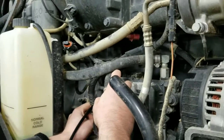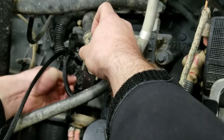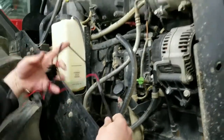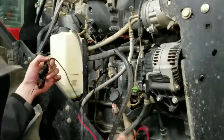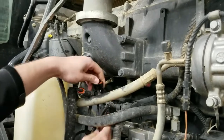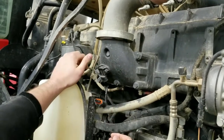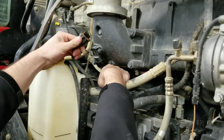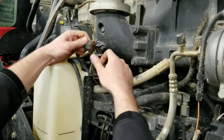Then we can go ahead and take the other ECM connector and connect it as well. Now we will take the female map sensor connector from our harness and plug it into the sensor itself. We use all factory OEM connectors, so we'll take the female portion from our harness and go into the map sensor. Make sure all connections snap into place — that's when you know they're connected properly, as we heard that snap. We'll now take the female connector from the factory engine harness and go to our male connector. There's only one way for these to go on — make sure the locking tab is on the ramp side.